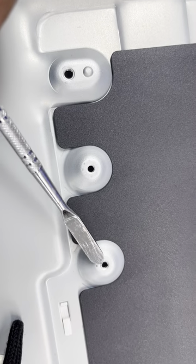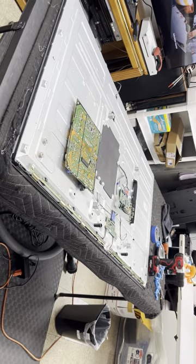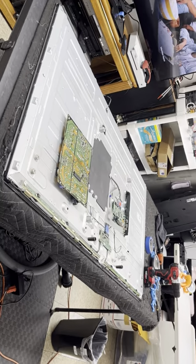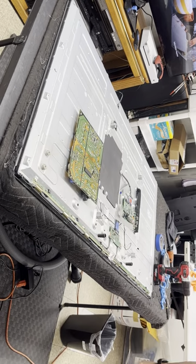See that? Where there's carbon, there's resistance. So there's resistance added to the circuit. It shouldn't be in the circuit. So I'm gonna clean that off with a wire brush, and I'm gonna redo these solder contacts. Add a little solder to them, you know, make them round again.